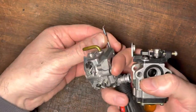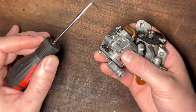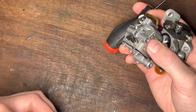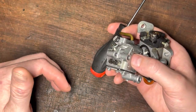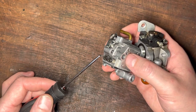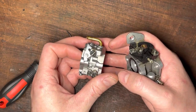But more often than not, that slow RPM decrease over about 15 to 30 seconds is too much fuel on the low side. Give yourself a bit less fuel — turn it in a quarter to an eighth of a turn — and you should see that improve.